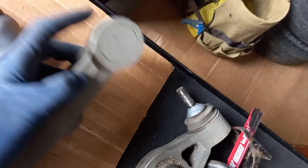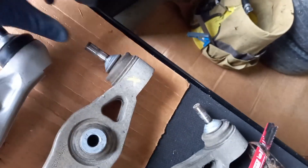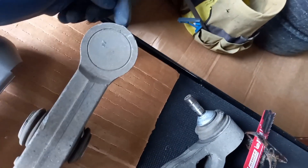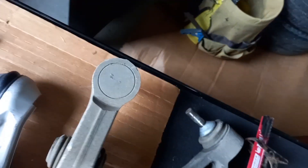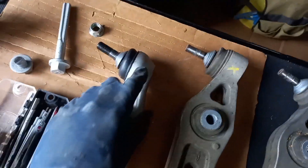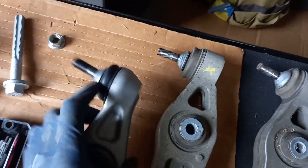What I do know is that I've had one of these fail, where the middle circle — the ball joint that gets pushed in — basically the suspension arm is only the outer bit, and I had one where it snapped along that line and fell out. Luckily it was only being driven around a workshop, but the car's suspension basically collapsed. So hopefully this one is the upgraded, stronger version, because it's got more metal around there.